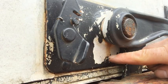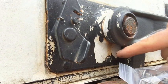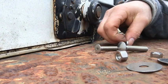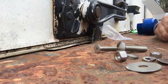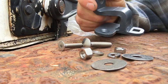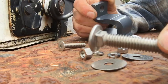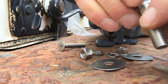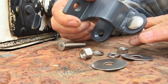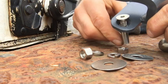You have to do a little bit of prep work. Right in here you have a carriage bolt that you have to remove. They give you a little bag of hardware to replace what you take out, so you're going to get two bolts, two nuts, two fender washers, and two lock washers. This little kit did not come with instructions, so I'm kind of learning on the fly. The carriage bolt has the square portion — these look like stainless as well, so that's nice — and that will drop into the square hole.